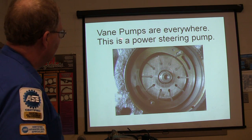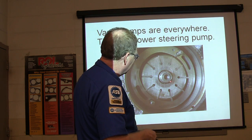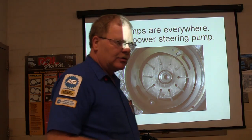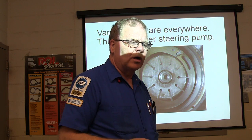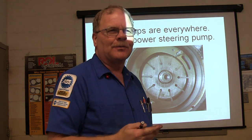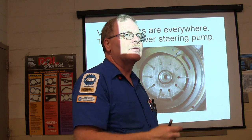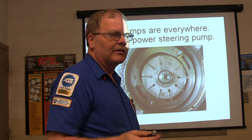This is what one looks like — this is a power steering pump. You can pull a power steering pump apart, and these are what the vanes look like on the inside. That is a vane pump. These vanes can slide in and out, and see how it's egg-shaped? One time I was working at Fort Rucker — a bucket truck that wouldn't work, no hydraulics. I got under it and found the center of that pump had been put in backwards when they built it. Because I'd worked on forklifts, I recognized it. You couldn't tell if you hadn't seen one before — made you look like a superhero.